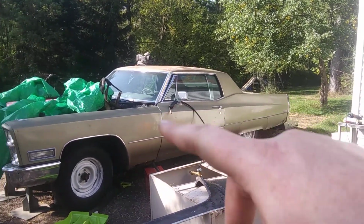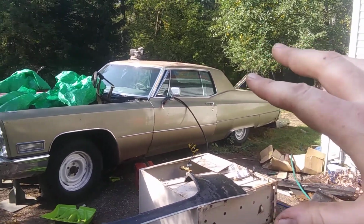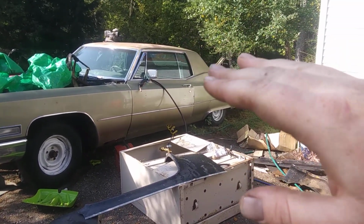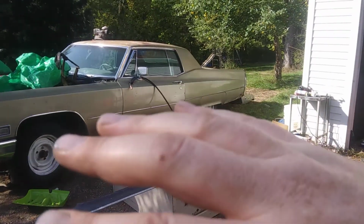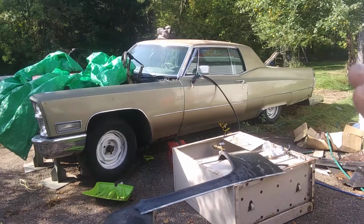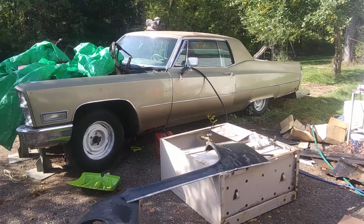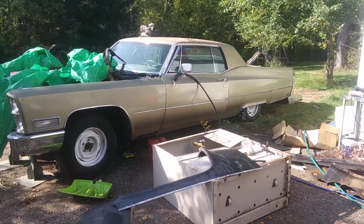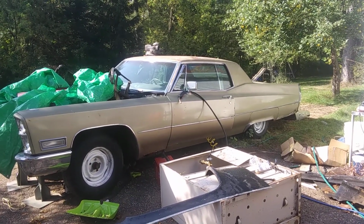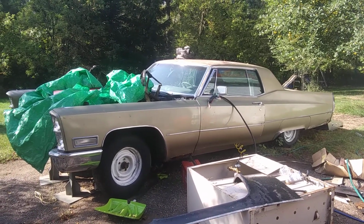I had to do all the floor pans and everything first because there wasn't a lot of structural integrity left with all that rust. But now, with all the new pans, they're made out of 14 and 16 gauge, fully TIG welded. It's going to be super solid. I mean, this thing's going to be like a unibody car, but it's going to be on a full chassis, and it's going to be heavy. I'm probably thinking, by the time I get done adding all this heavy gauge steel to this thing, it's probably going to be pushing like 5,200 pounds. And I'm going to need a big motor in there. So that's also one of the next videos too.